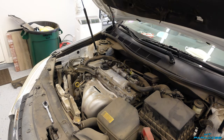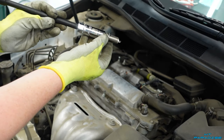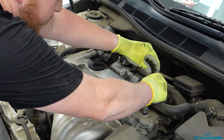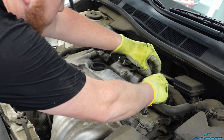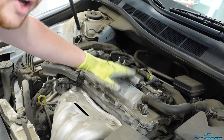There's also going to be a link in the description down below for the ignition coil, so definitely go check those out. We're going to go ahead and put the new spark plugs in the little socket and then drop it down into each cylinder. Do not use power tools on this because you definitely do not want to end up stripping it. Just use it hand tight, then go ahead and do the other three.